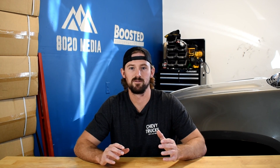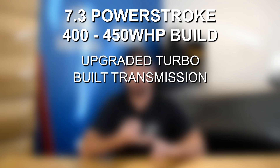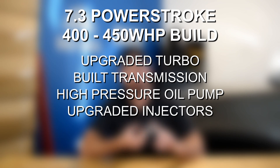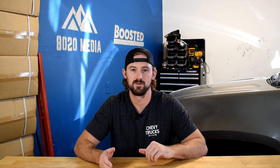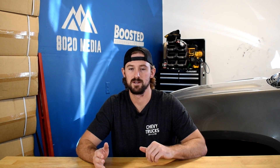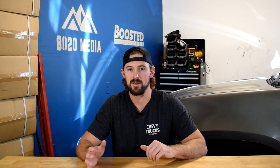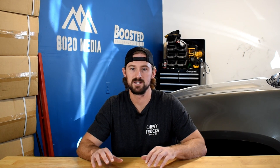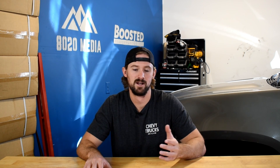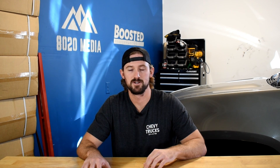Once you start pushing beyond this, you're looking at probably $10,000 plus in upgrades to really get to the 400 to 450 wheel horsepower mark reliably. There you're going to need a turbo upgrade, a built transmission, an HPOP, injectors, fuel system upgrades, as well as all of these bolt-on modifications. These trucks are pretty expensive to get to those power levels, and pushing anything beyond 450 is when it starts to get extra expensive. One of the best things I think with the 7.3 is to throw these four modifications on there and be happy with the 300 to 325 wheel horsepower that you're pushing, unless you have a big budget and you're trying to do a high horsepower build. It's just expensive and the 7.3 is not quite as favorable as a platform for modifications compared to some of the other diesel engines of the time.